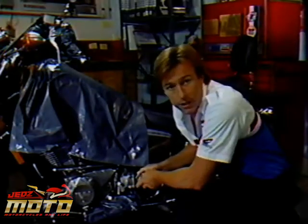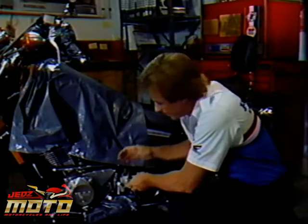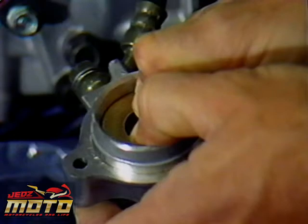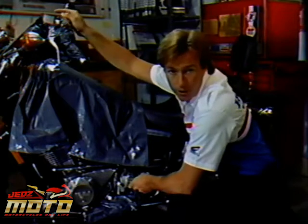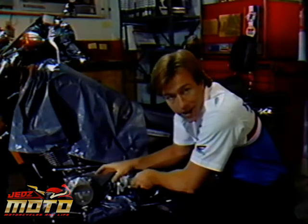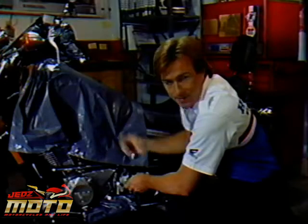Here's another tip for getting trapped air bubbles out. Remove the slave cylinder from the engine and push the piston in. I keep an eye on the master cylinder level. Now this can force the air bubble back to the master cylinder or to the high point just before it. Once you get the air to that point, all you have to do is bolt the slave cylinder back on and keep the reservoir high while pumping to get the bubbles out.